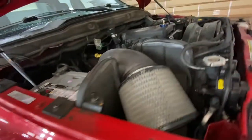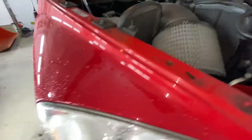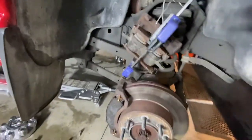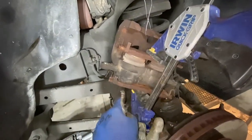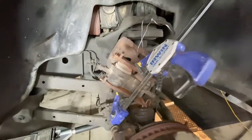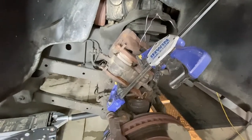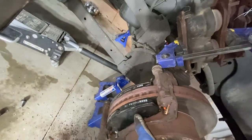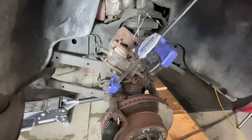I've taken the cap off the brake fluid reservoir up top here. I've taken the old set of brake pads and placed them on top of the pistons and on the other side of the caliper so I have a flat spot to put my clamp on. I'm going to just reef on that with my clamp to put those pistons back in place in order to slip it over the new pads, which are much thicker than the old worn ones.